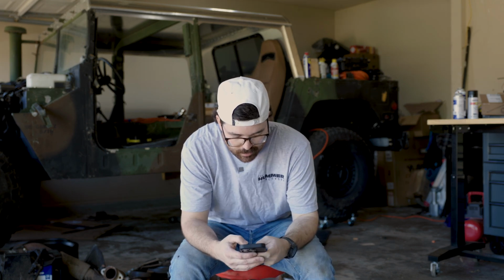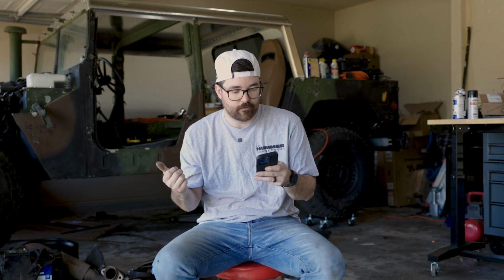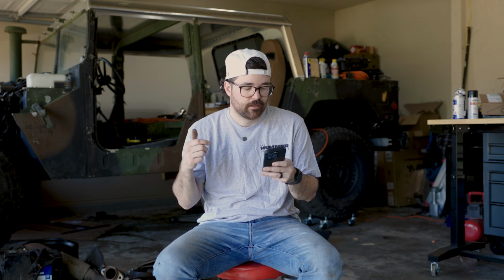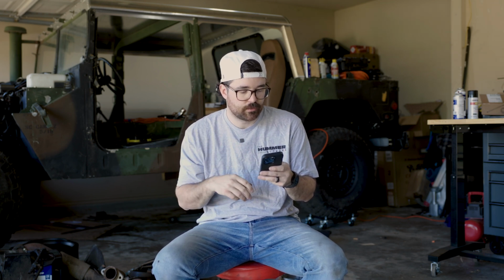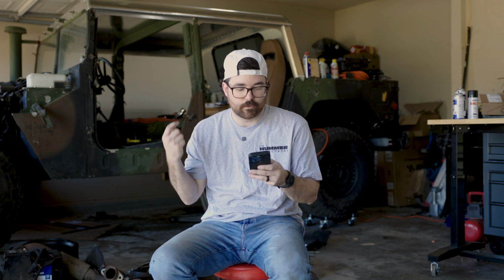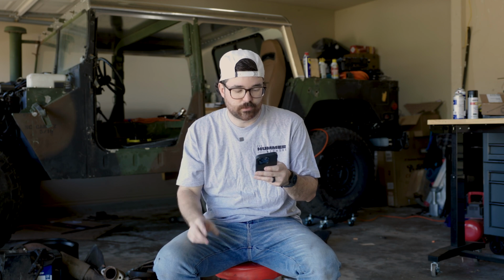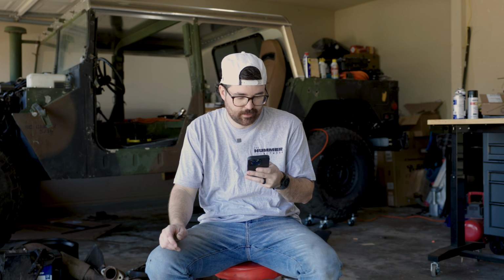Let's kind of go through the highlights, see if there's anything I'm missing. So all this will be below, but move the temp switch out of the right rear head to either the front or the thermostat crossover tube. And then install a quality aftermarket temp sensor at the right rear. That's where the issues are, the critical spot on the block right there. So that'll give me a pretty good reading, and if it gets too hot, I can pull over, but I can't do any of that until it's running.